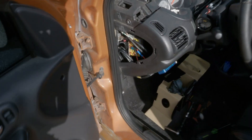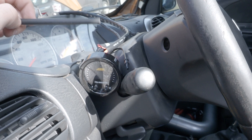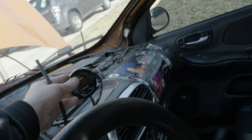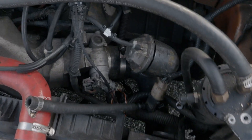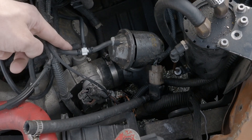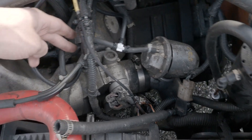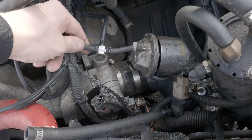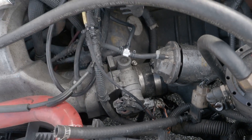On the inside, we found a spot to tap for 12-volt power on ignition and ran our boost reference line up into the dash — the gauge is going to sit right there. For the boost reference, we're coming out right at the throttle body, usually where your blow-off valve should be connected. We just put a T-fitting in there, and that's what we're using to grab boost reference.